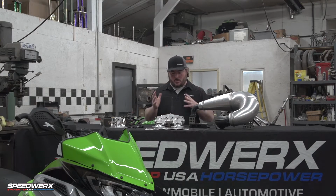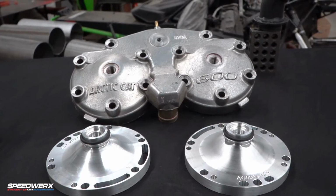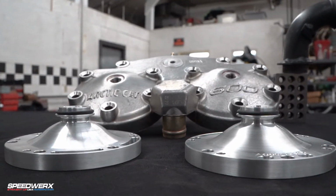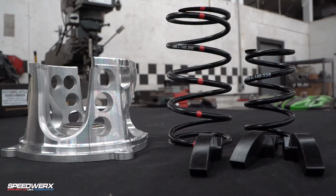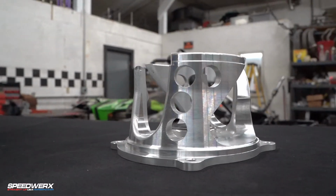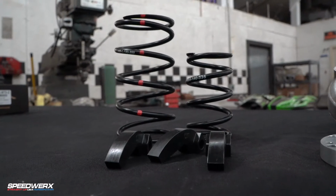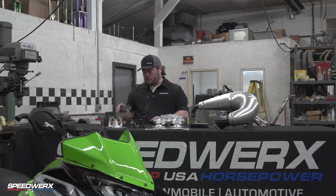What that first stage kit consists of is our stealth head mod, sleeper head kit, where you send in your stock head, we gut everything out, we put in our interchangeable billet dome inserts. Hypershift Clutch Kit comes with an H5 alloy primary and secondary spring. One of our lightweight Team Boss helixes with a compound radius cut, and a set of our machined adjustable Hypershift clutch weights. Another thing in Stage 1 is these V-Force Reeds.